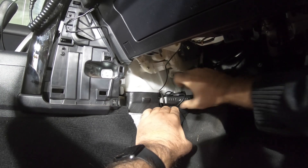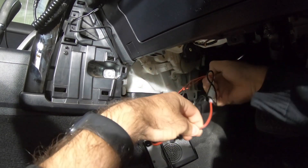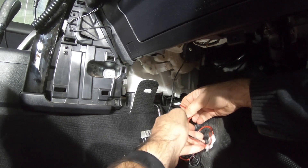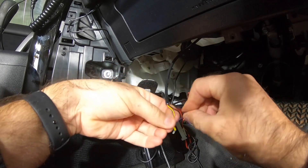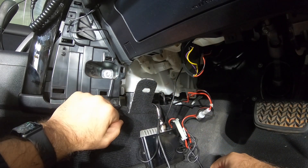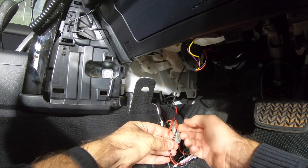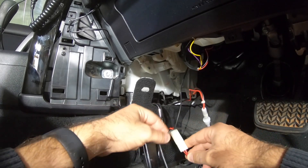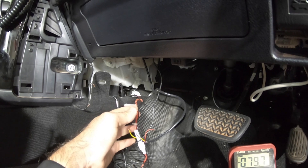So we'll just pop him out. So somewhere — there you go — this here comes from the auxiliary battery specifically to power that radio. So here are the wires from the gauge: ground, ignition, and the two batteries. So I'm going to tee into here for the accessories and into here for the auxiliary battery.